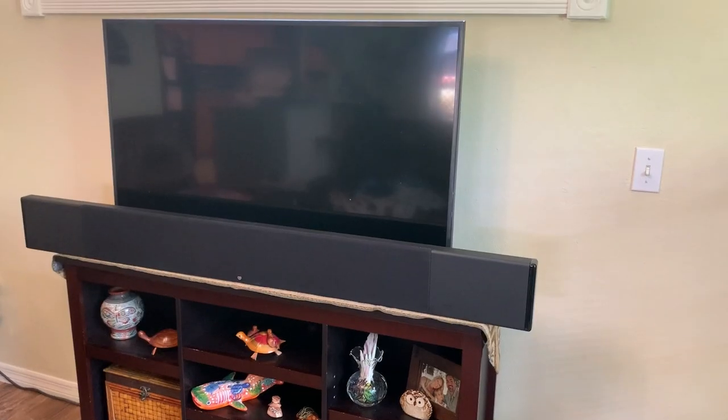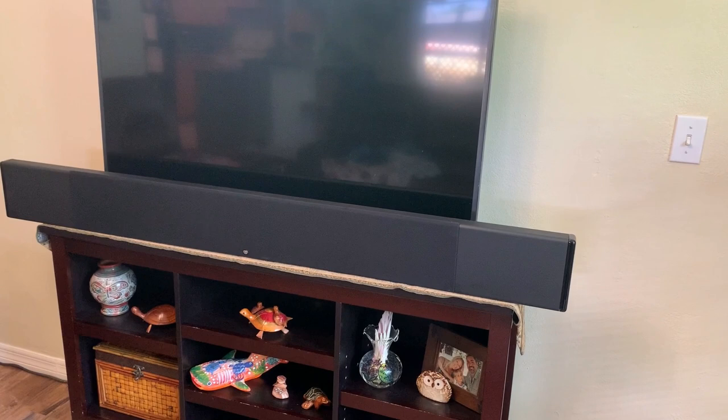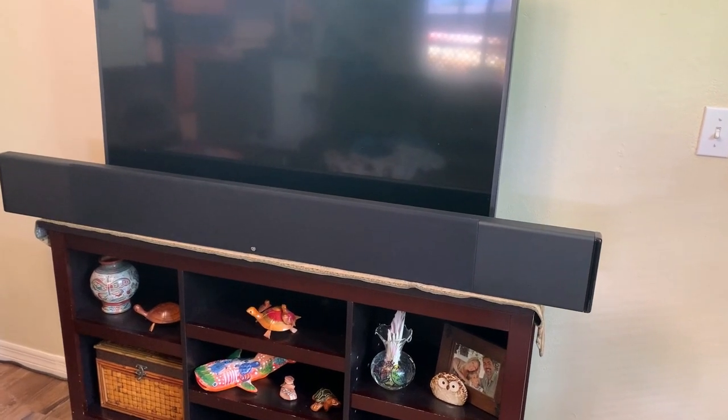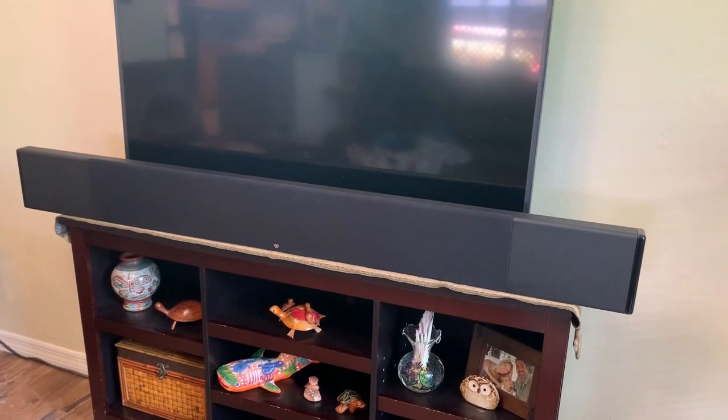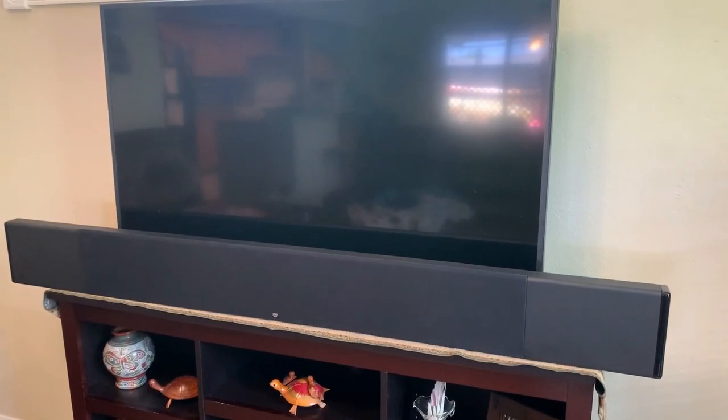Let's check out this cabinet. It feels pretty solid and it's hefty. It's made of MDF with internal bracing, and each chamber is sealed — left, center, and right — for each channel. The end caps are MDF also, covered in high gloss black paint. This version of the Ultra 3 weighs in at about 12.5 pounds, and it goes down to about 9.5 pounds for a 47-inch unit.